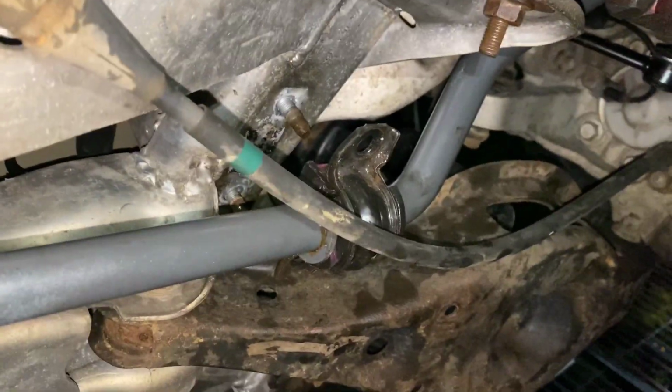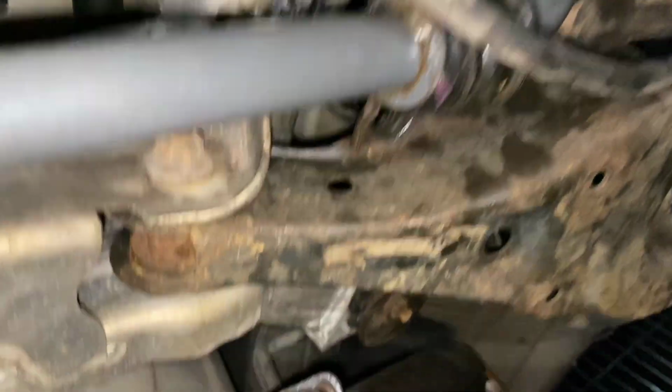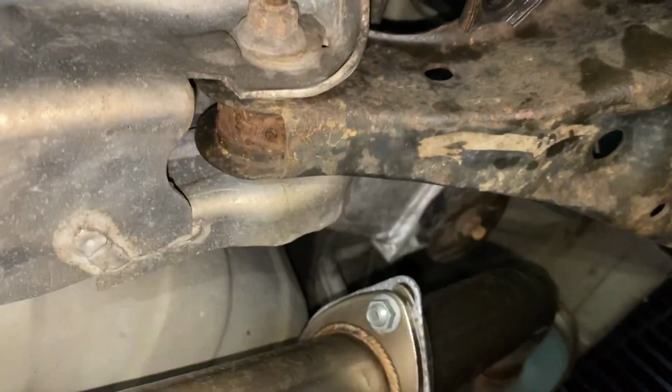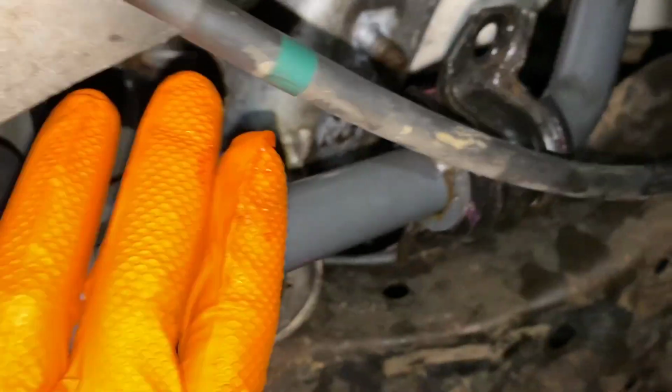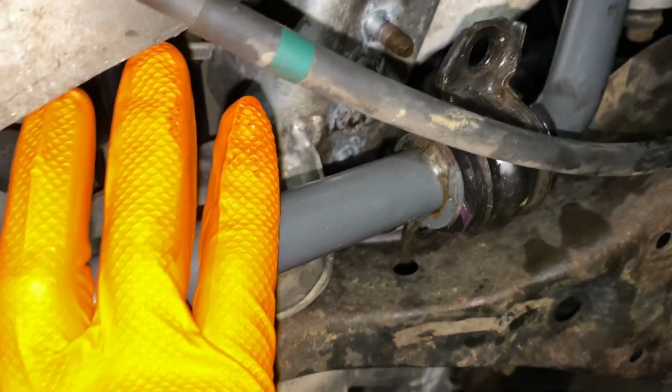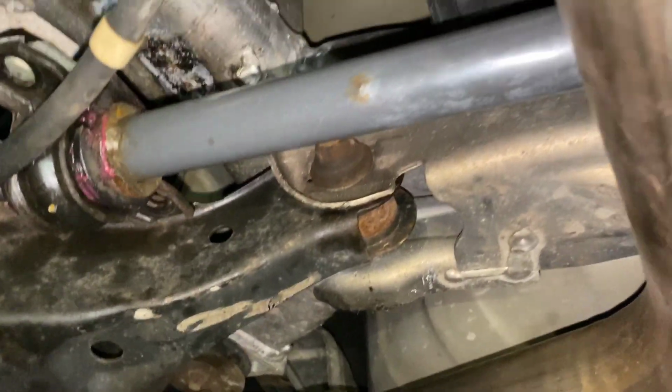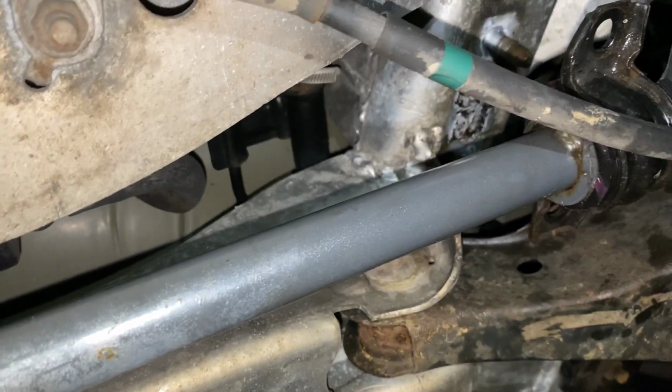Let's go. Got the bushings on, got the bracket on. Under the bracket you can see the grease, have it on non-sparingly. I just wanted to make sure I got a nice amount on the inside. Now that that's lubed up, I'm gonna raise this up so I can get the bracket to line up on both sides, but I'll take it one side at a time and just get one bolt on there. So now that'll hold it up and give me a good starting point.